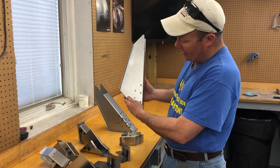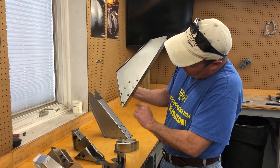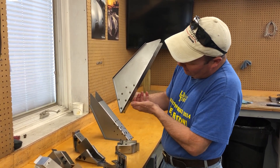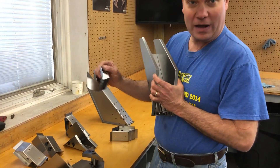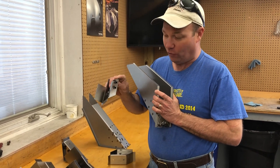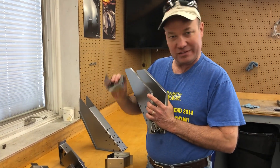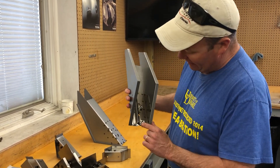We do sell a lot of these. Usually this will rust out down in here, all in here behind the sway bar mount, because it's got this reinforcing piece. I do want to show you this — Brent made these, by the way. It was a group effort. I patterned these yesterday. Brent folded them up, welded these edges.